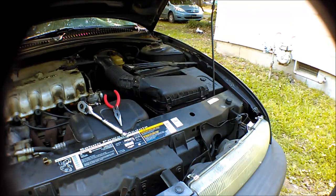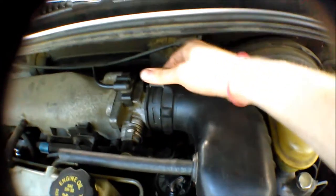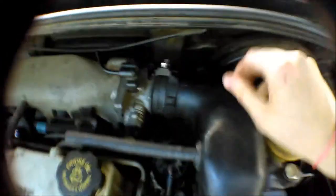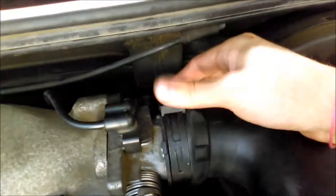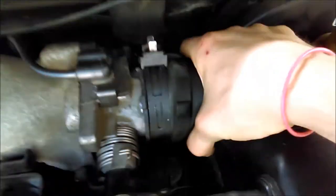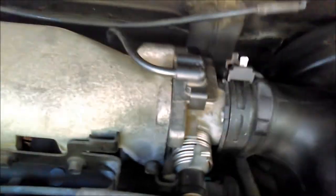Are you going to be able to see this? Here's the guy that's going to give us trouble today. There's a little clamp in there, as you can see, and of course it's really hot. You're going to want to squeeze this until it loosens the clamp and wiggle it right off the throttle body. We got that off — and I only cried for 20 minutes. So that opens the throttle body up for us.